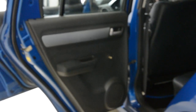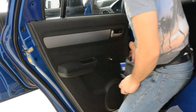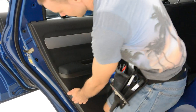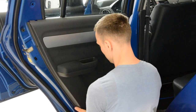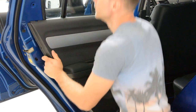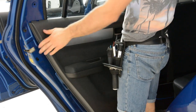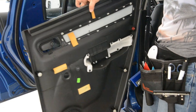After you take the screws and the handle, you have just the clips. You will have some space here to put your hand and pull the clips. And now at the top, pull up. This is your door panel — done.